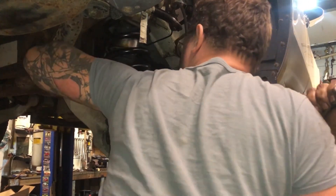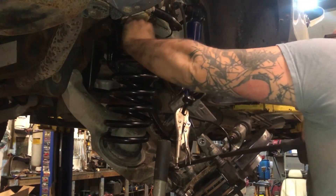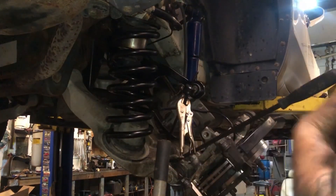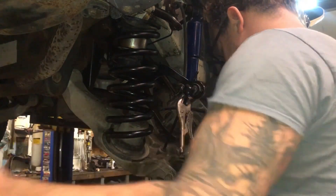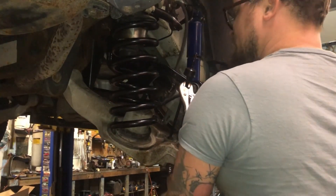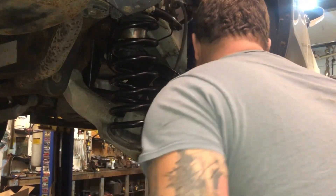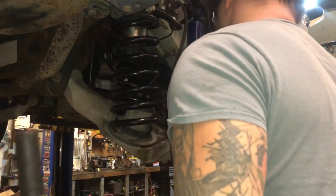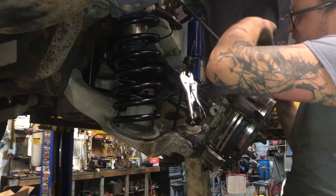Pull this arm down with the bar and fit the bottom in. The bottom is going to fit into a little groove — there's a little step where your coil spring end goes. Make sure it's in that step and get her into position. Get the bar out of the way, bring the jack back up, and it popped into place on its own. Start jacking her up on that flat spot. Watch this middle control arm — it can try to jam up on you, so keep an eye on it.